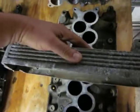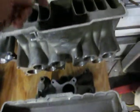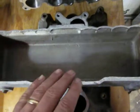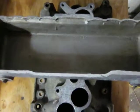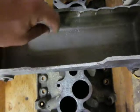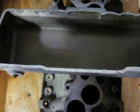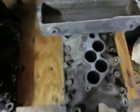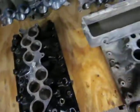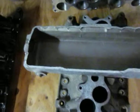What I forgot to show on the last one — this is the backside of the plenum. When the air comes in through the crossover, it splatters up against this flat wall and there's nothing back there to turn the air either way. So what I'm going to do is put some kind of a divider in there, either like a round tube or a 90-degree angle piece of aluminum, just a little something in there to get the air to turn from either side. I won't be able to do a back-to-back comparison with versus without a divider, but I think it'll help.